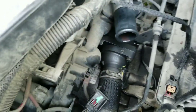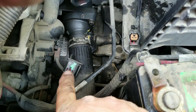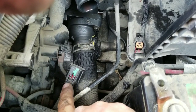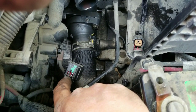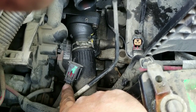Taking the clip off — it looks like this has already been done before, there's a mechanic's pen on there. You take the little red clip out, pop the red clip, then push on this little red thing here and it comes right out. On older cars it's the opposite — you pull up on it and pull it out.